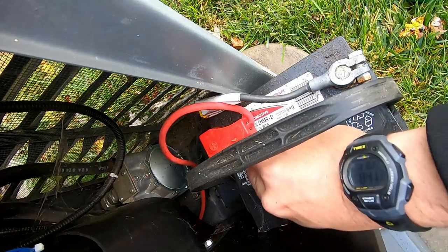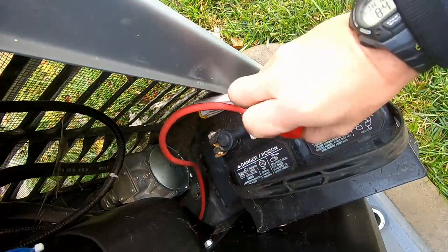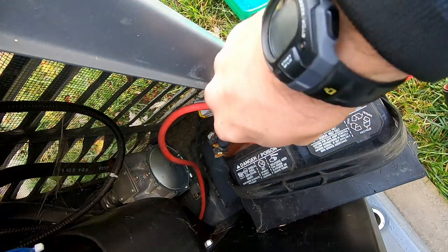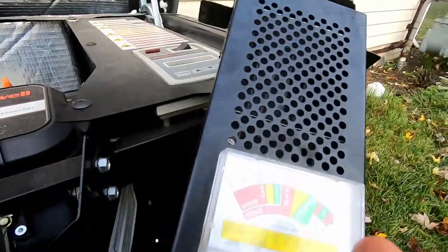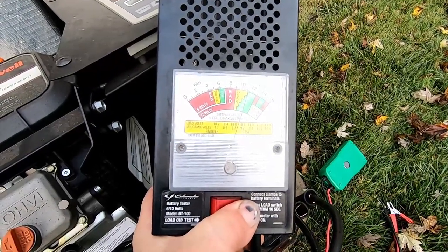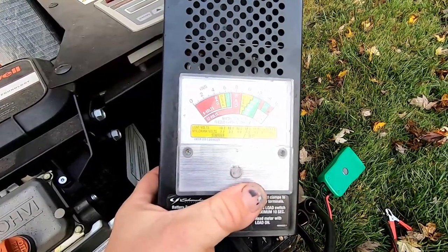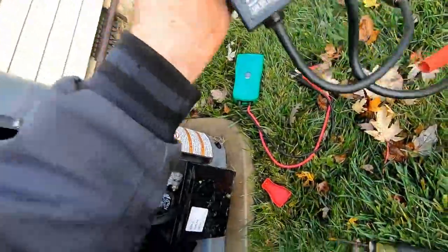When we do the load test we want to remove it from the circuitry. You've got to be really careful because you don't want to overload it, and some batteries have been known to explode. Coming in here, we're looking at the meter — we're up around over 14 volts. We hit the load switch — you don't want to hold it for more than 10 seconds. It's getting warm, holding around 11.2 volts. It bounced back up quickly and went down slowly, so the battery is most likely fine.